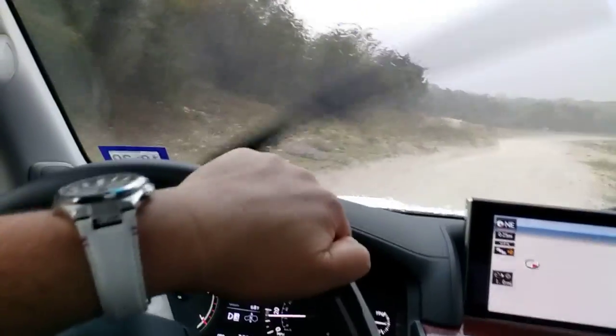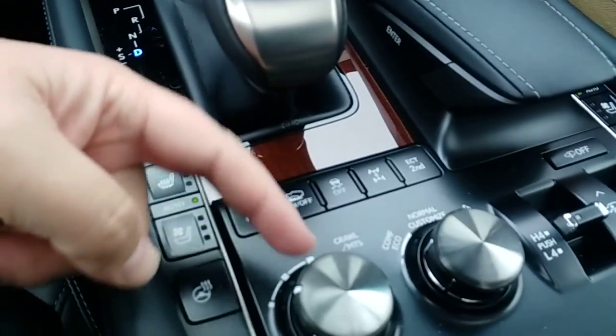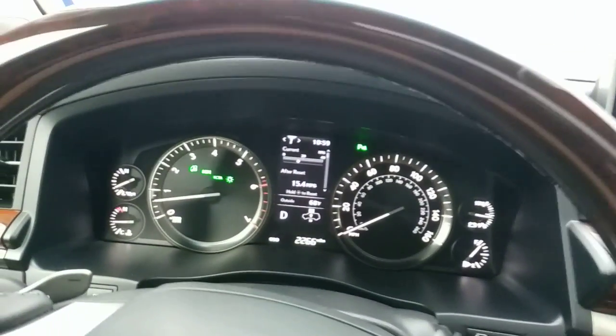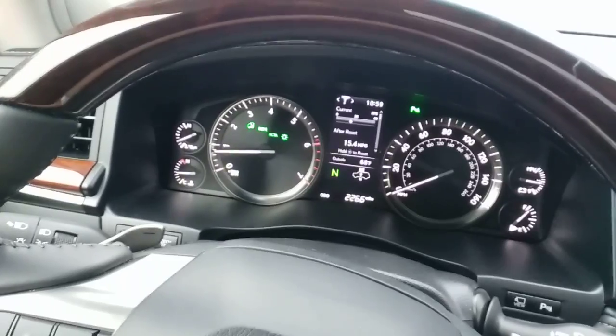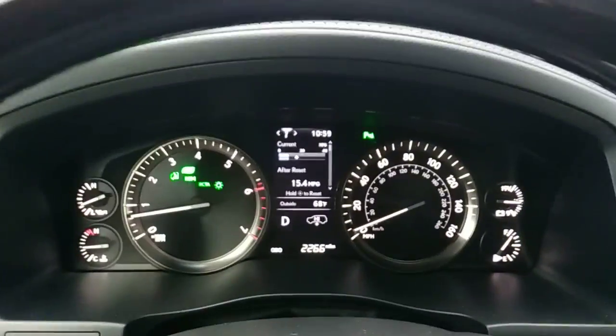I also want to say, what really annoys me is I feel like we should raise the suspension, because you'll see there it's in normal mode. And we'll stop and we'll hit up and it will raise. However, as we drive along, it's going to lower down to normal again, which is pointless, right? Because if we don't even really need a diff lock and we don't really need any crawl control, why is it automatically lowering again? So I'm going to assume that once it's raised, which it hasn't done yet, because we're in drive. If I go to neutral, see, I don't understand. I don't know why it's so technical. There are other vehicles that just do. There we go. Okay, so it's in high. And now I'm going to press off. And hopefully that'll keep it in the high mode. We'll find out if it lowers when we get to certain speeds.